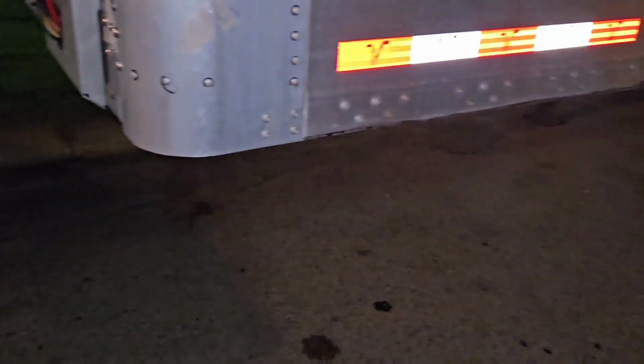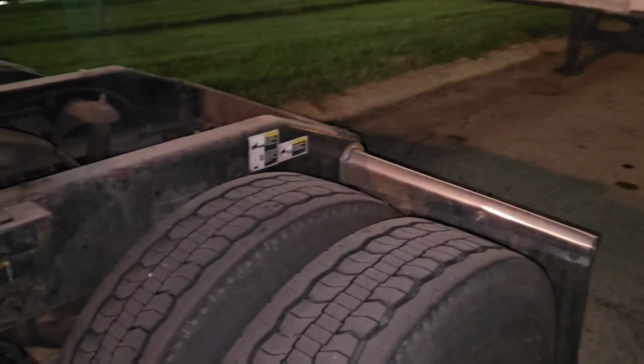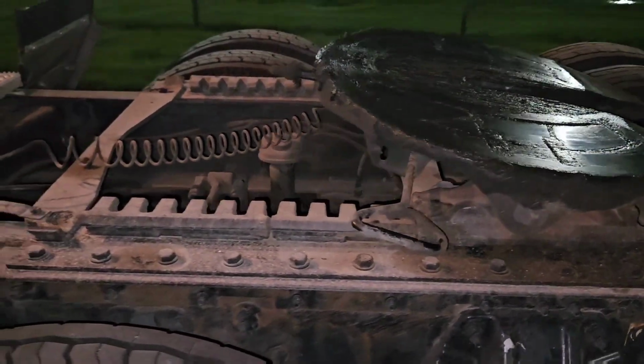I kind of have it gauged out just right to where I'll connect and I'll let the stability of the trailer being on the ground push the fifth wheel up and back, because any other way it typically doesn't work. When your landing gear is up and you just have all that weight sitting down, those pins typically don't like to come in. So lower your landing gear. That's what I do. It only takes you an extra minute.